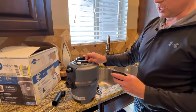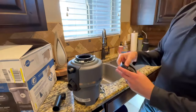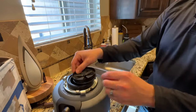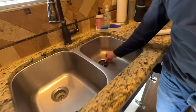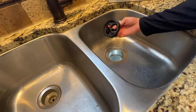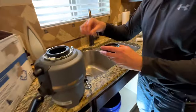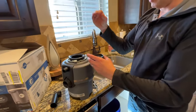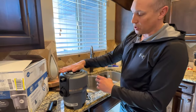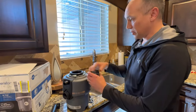Now we're figuring out the order of the rubber gaskets on top of the disposal. This piece came already on top — it's like a little strainer thing. It actually just sits right on top of the strainer basket and comes out — it doesn't get installed inside. The instructions aren't very clear, but they do show the stacking order. This gasket is the one that mates right up to the bottom of the connector.